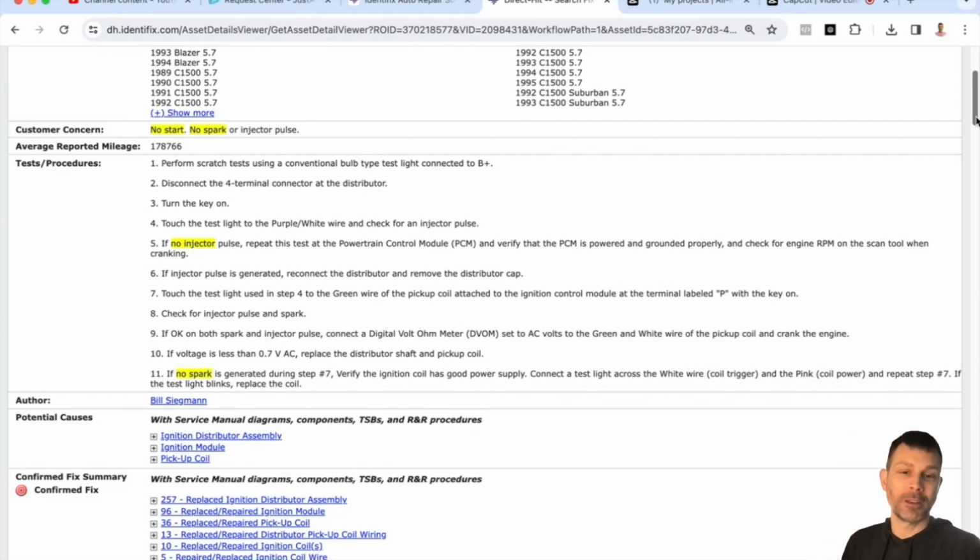Hang on. I understand that, but that doesn't change my answer. We still need to run the test. Okay. So if the coil's not sparking, what's the next thing? Well, you said we're going to check for spark. I'm visualizing I checked for spark, and there's no spark. Then I went to the coil, checked for spark, which is what I did before all this happened, and there's no spark. And you said the next thing to check would be the wiring in the ignition. Yes, sir. We have to make sure it's got power. What am I checking in the ignition?